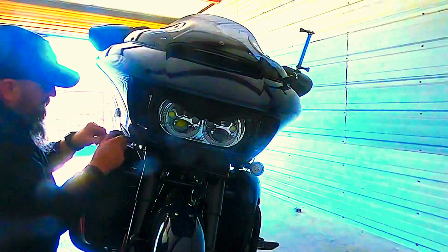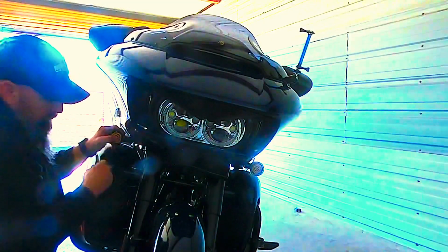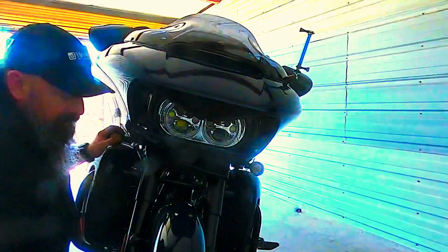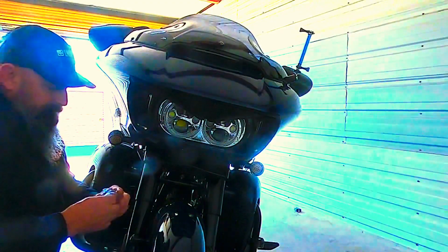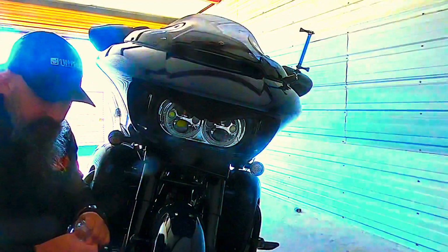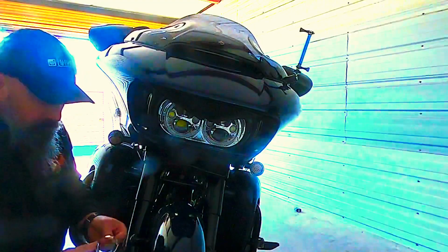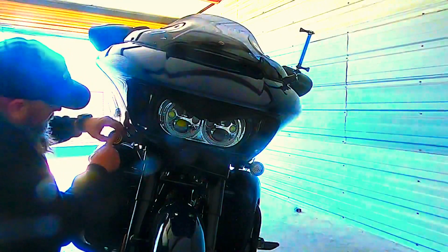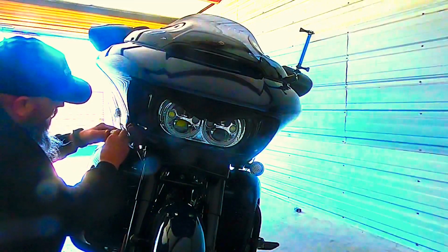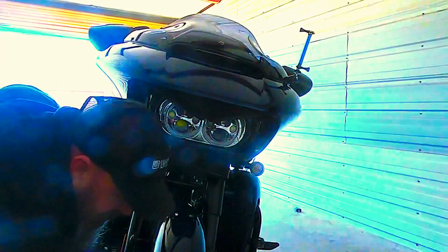Again, coil these and push your cap in there. I did not unwrap this, so I'm going to need to unwrap this real quick. So the trouble that I was having putting that light panel in there was all me, because I didn't pay attention to the orientation of putting it in there. Again, Custom Dynamics logo to the top, and just as simple as popping that lens cap in there, and now our lights have been changed.